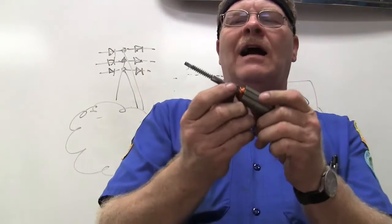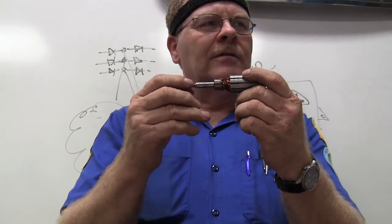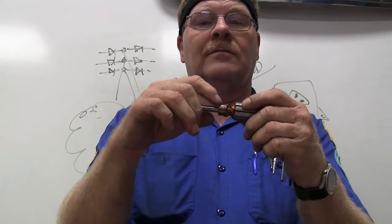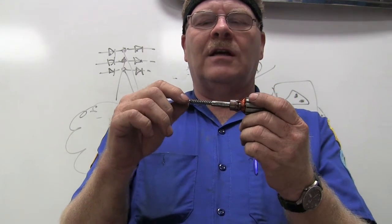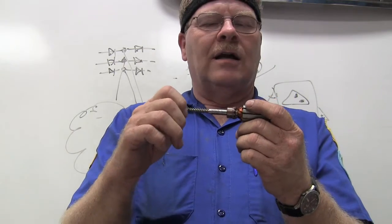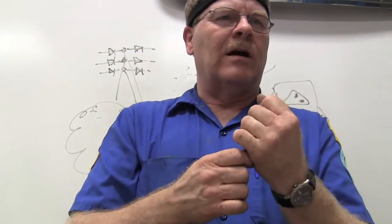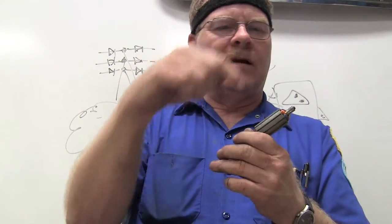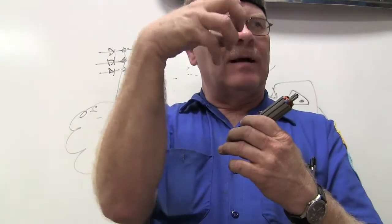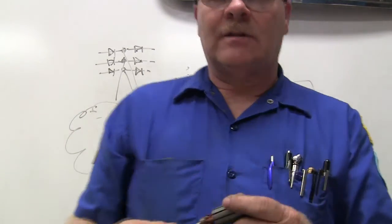See? Now I could actually turn one of these little power window motors into a generator if I hooked up to the two brushes. You can take any DC motor, hook it up to the two brushes, and spin this with a drill, and it would create all kinds of power, because on the newer power window motors you've got permanent magnets out here, which is the same thing. The field coil had big bands of copper wrapped around these cores that were screwed to the case. Anyway, that's what that was all about.